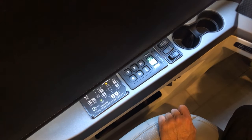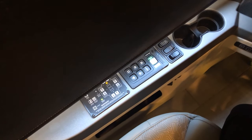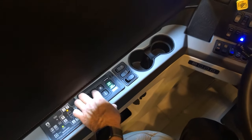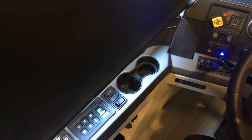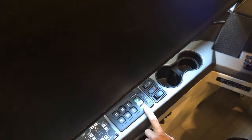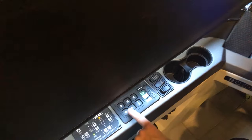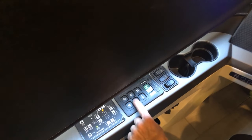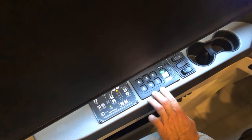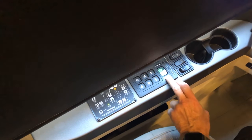Put your foot on the brake before switching into gear. To move the coach you have to release the parking brake by pushing it forward. When you park, put it in neutral. There is a mode button to scroll through engine oil temp and errors. Once the transmission is up to temperature you can simultaneously press the mode button and the plus arrow to see the oil level in your transmission.